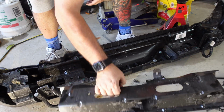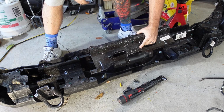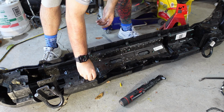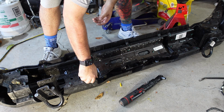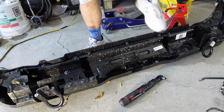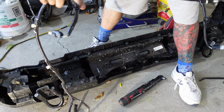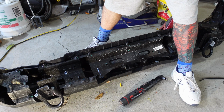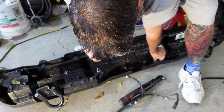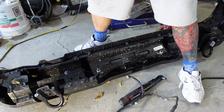Did take this plate off to make pulling the wiring harness out of there a little easier. So we can go ahead and put that back together now. And it was just 5 of these 13mm bolts. I'll go ahead and tighten that back down so we have everything together. But this is what we were after, taking this wiring harness out of here. And we're going to transfer that over to the new bumper along with these sensors. So let me get this all cleaned up and we'll get moved over there.